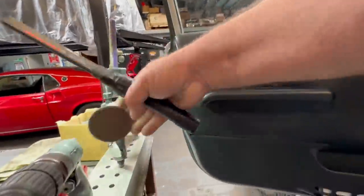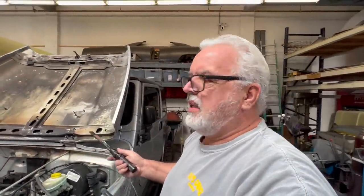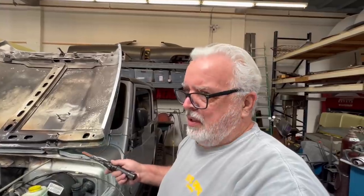So the idea of doing electrical repair is not to just swap out the wiring harness and call it a day. It is to put the car back in pre-accident or pre-fire condition. So I can see already that some of the adhesive panel bond that they used to put the lower cowl in, and seal the passenger compartment from the engine compartment, has seen a bunch of heat and sweat it out. So I'm gonna dig that out and use panel bond on that.